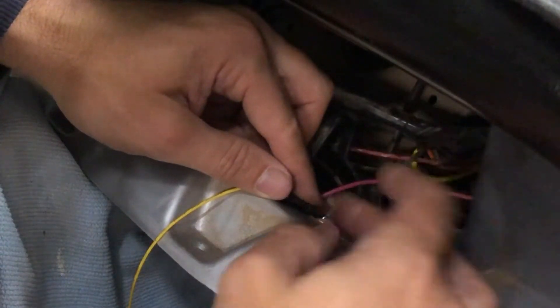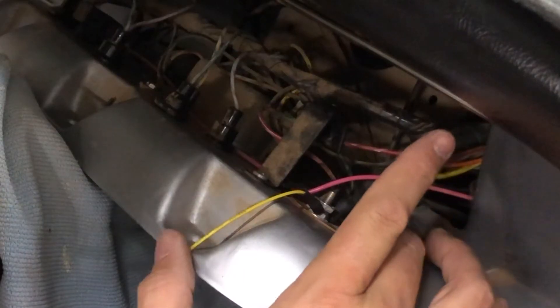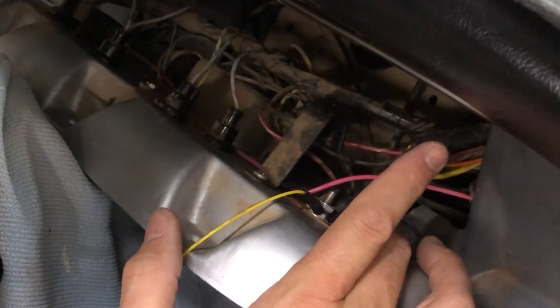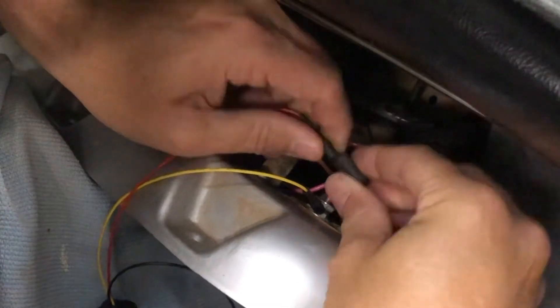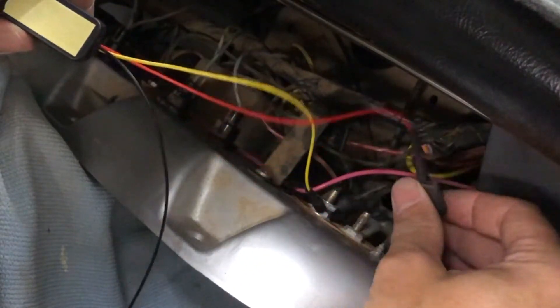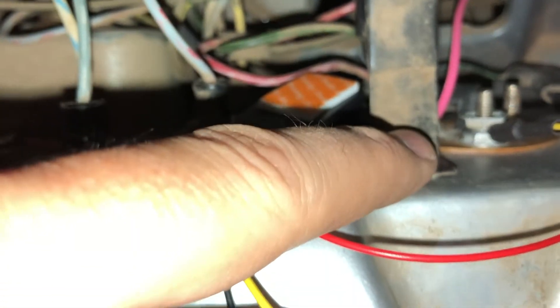I've just adapted using the nuts I've got so I can get that five volt connector on there. I've removed the connectors from the original 12 volt into that gauge, because we never want anything connected to that anymore — we're bypassing the bi-metallic strip between those two terminals. I've hooked up the 12 volt into the digital voltage regulator, and now I just need to find a good ground connection. I can see this screw that goes to the bracket which holds the main wiring loom — it's clearly a good solid screw into the metal dash, so that'll be a good ground.